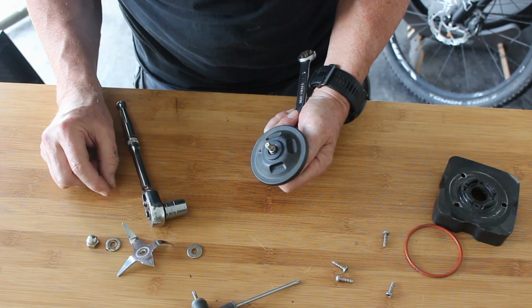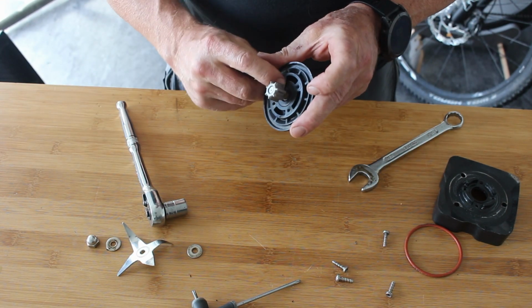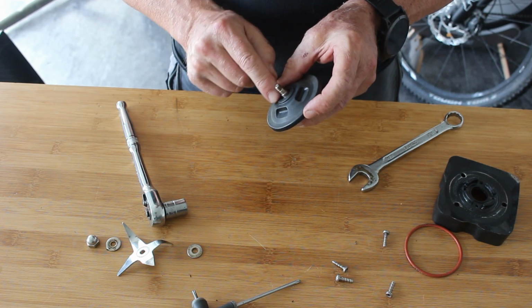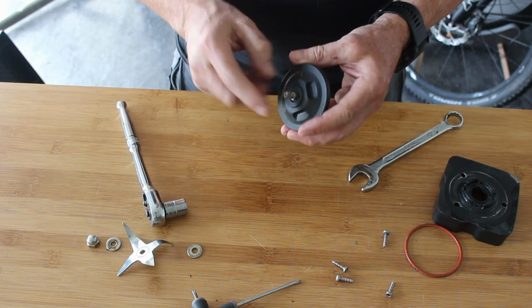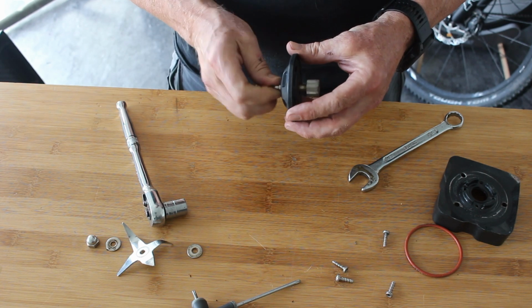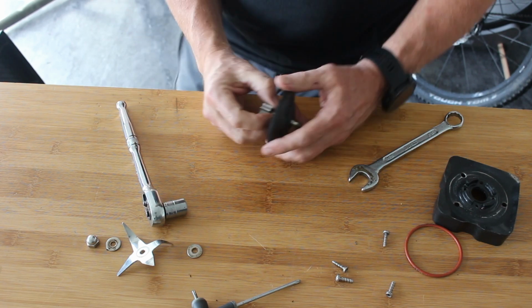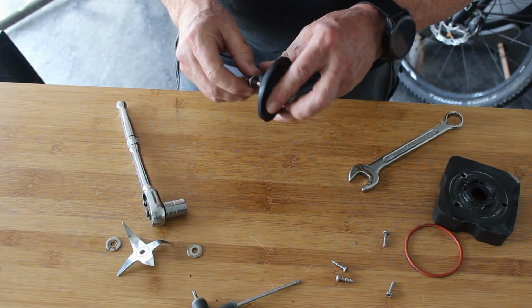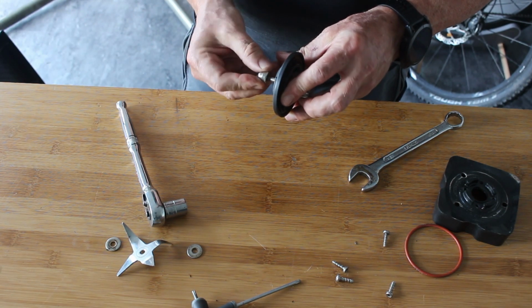It's a stainless steel dome head nut. Don't know what you call them in the States. There's two stainless steel washers there, so there is no indexing on the flat side or anything that keys the blade to the shaft. It's purely on the friction of those two washers. So you do need to make sure you got it nice and tight, but don't over tighten it, because if it does start to spin, it'll tighten the nut up anyway.